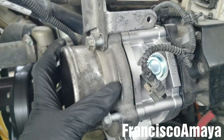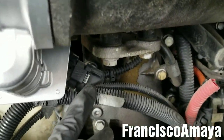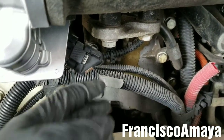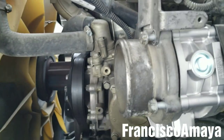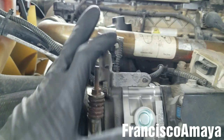I'm going to tie all the bolts — don't over-tighten. Then I'm going to put the harness back together. Remember to put the throttle valve plug and the secure clip that goes in the rear area, and then install the hose. Now the throttle valve is fully replaced — I'm just going to double check everything, the bolts and all cables secured in the right position.